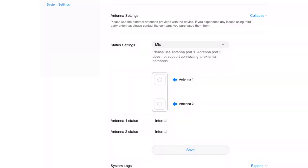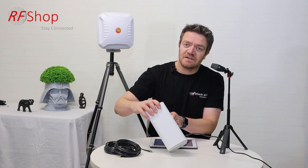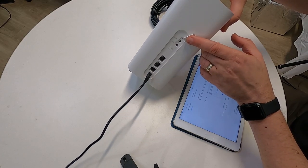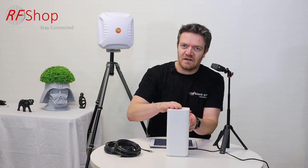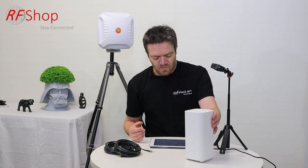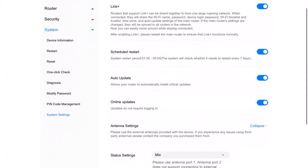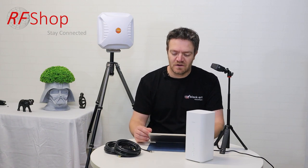Mix means antenna one and antenna two are on different ports — so antenna one, which is main, would be your external antenna, and diversity would remain as is using the internal antenna. Do not use a splitter. Do not use a single antenna split into two — that's basically what I want to say. That's all I can say at this point without doing anything specific, so let me quickly run you through the kit and connect it. If we get results, great. If not, at least you understand how it works, and then we'll look for good results in a weak spot.